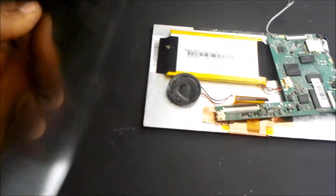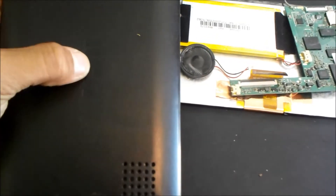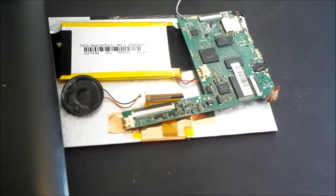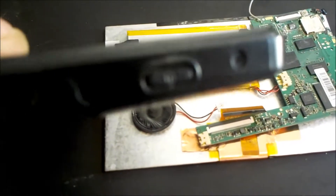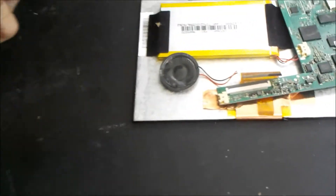Here's another tablet — it's the exact same RCA one, and this one is not taken apart, but I'm going to show you how I took it apart. Basically, there are these two screws at the top — you can see that screw right there and that screw right there next to the power button. You're just going to want to take those two screws off, and then you'll just pop this thing straight off. After you take those two screws out, you're going to pry from here and this thing will just basically pop straight out.